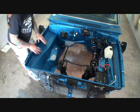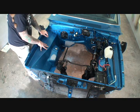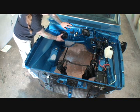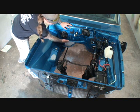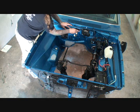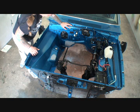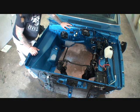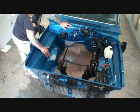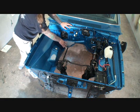We're going to come back and paint this area with base coat clear coat, because the last time I painted it he didn't like the way it looked. Over here we're going to use single stage urethane because that's what the car is painted with, and we've got to blend this section into all this section. I've removed all the AC lines and everything possible. Honestly, it's my opinion that redoing something like this is unnecessary — this area down here is all hidden, you don't even see it.